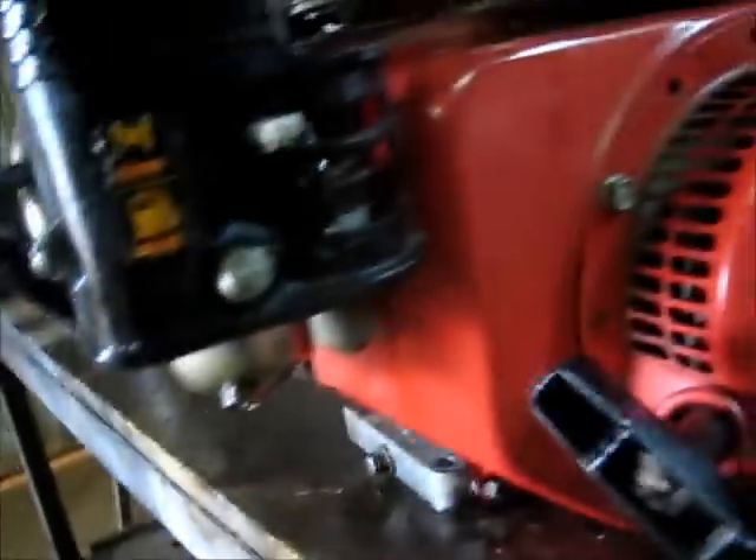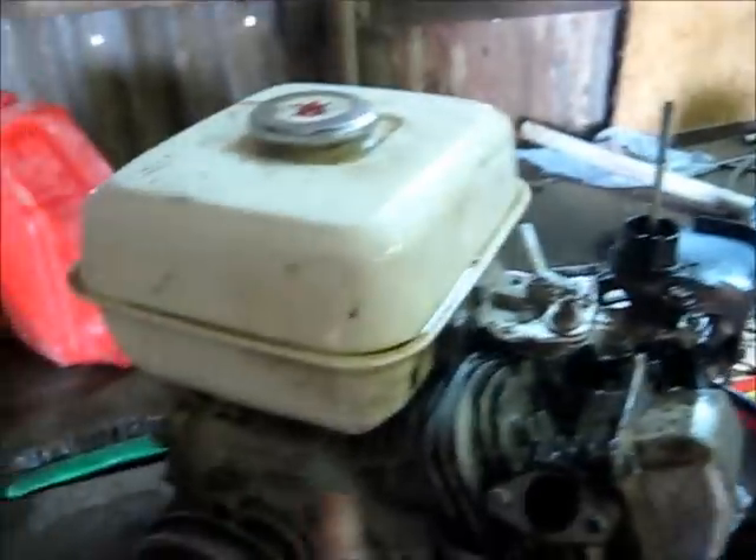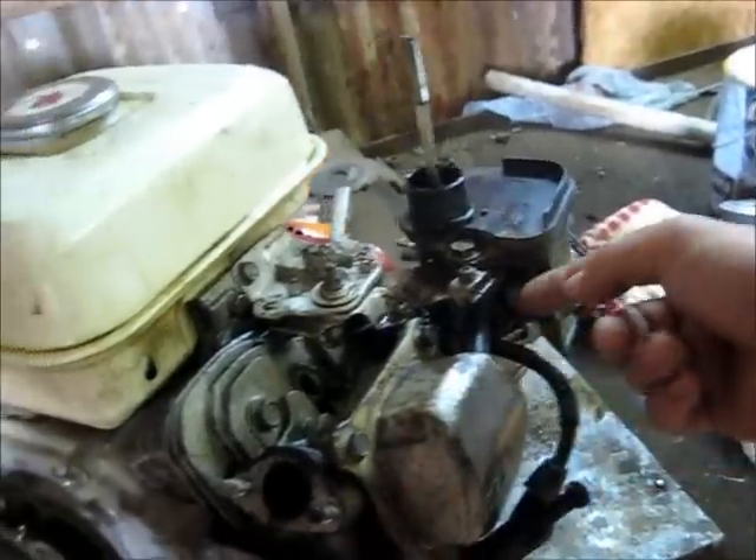What initially happened was: at the correct oil level, it has to be measured on this little sensor here. Only when the motor's in its correct angle will that oil level be the right level — not to trigger the safety shutoff. But when you're parked, depending on the ground you're parked on, it's not always on a straight angle, so it should tend to be below the sensor and not start. By the old man topping it up like an idiot, it put a little bit too much in and it's gone up behind the valve cover. Too much got in there and it's gone up through there and blown through there into the intake and into the cylinder.